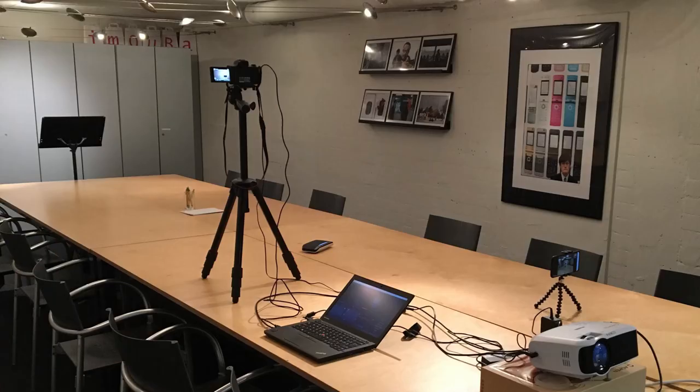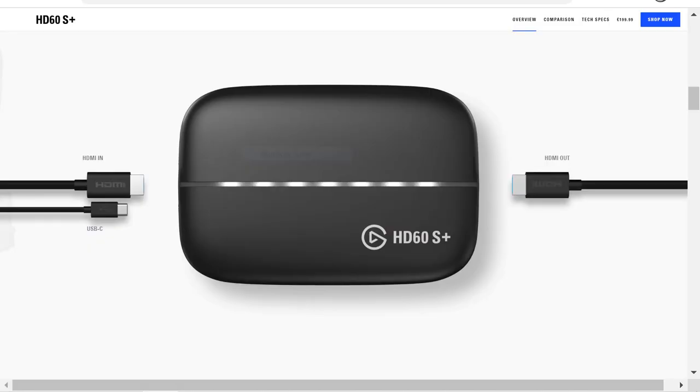There are two ways to connect a real camera to your laptop so it shows up as a webcam. The solution I typically use is to connect the Canon M50 with a USB cable and use the Canon EOS Webcam Utility — it will just show up as a webcam with no further equipment required. The other solution is to use an HDMI cable, which will require an HDMI input on your computer, best achieved with a capture card such as the Elgato Cam Link.